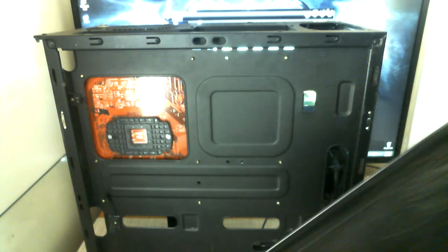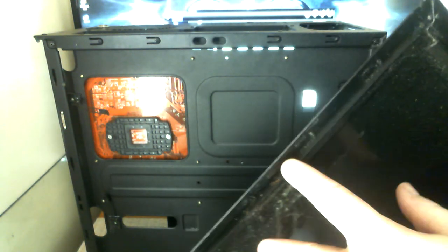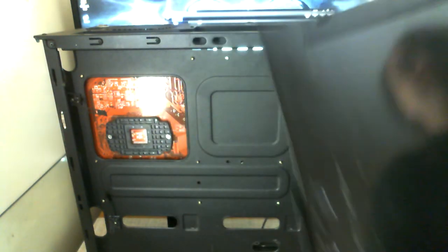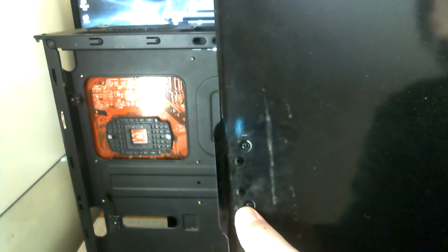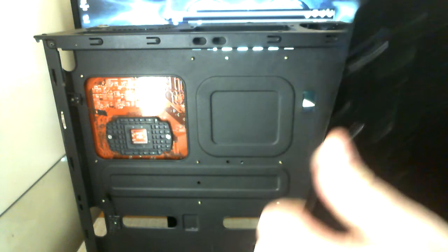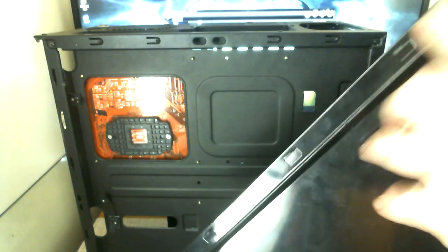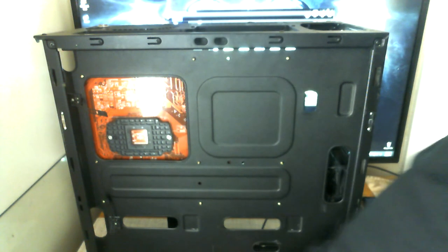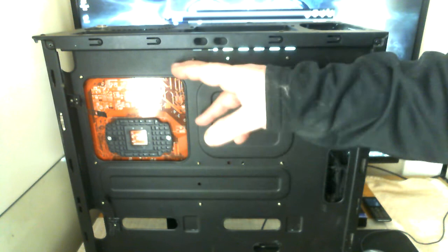If I push the button in and get my fingers in there, I can now remove the tray. What's nice about this tray is this lip right here mounts in and holds the tray very snug. There are two little holes that pop out and hold the tray from sliding out — a really neat design from Sente. There are tabs holding in the panel, and there's about a quarter to half inch of space behind the motherboard tray, plus a very large opening cutout.